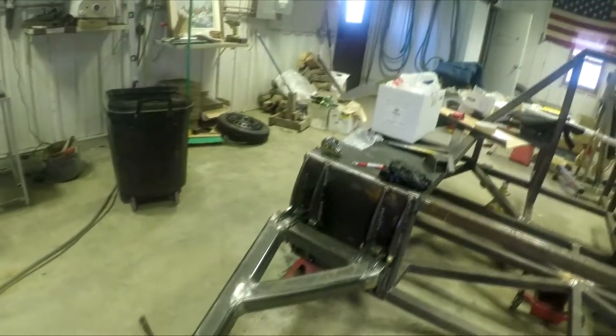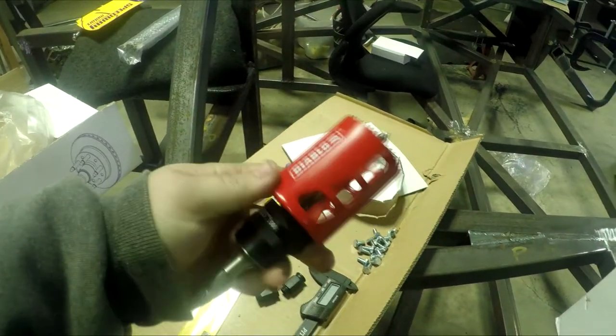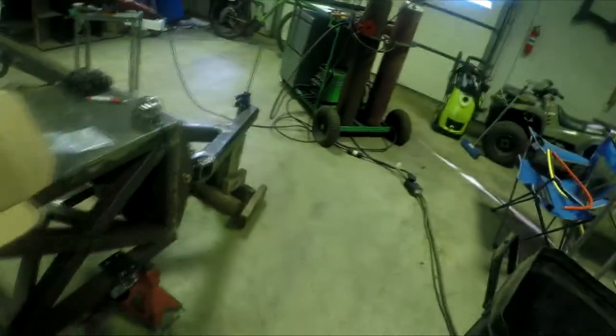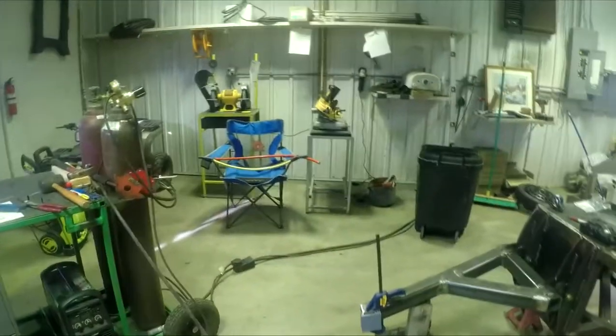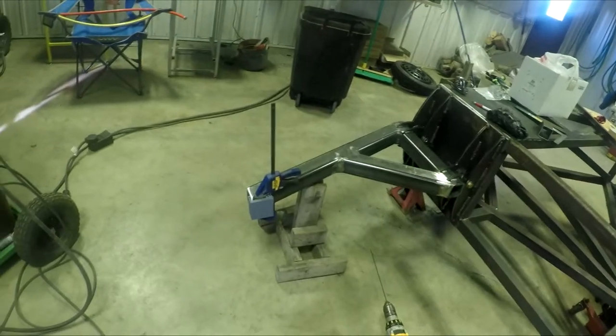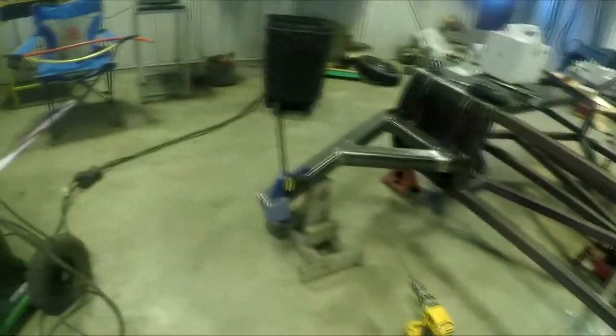And then we'll bump up to maybe go through with one other size. And then we got the hole saw here. 2-inch hole saw, Diablo. Cost me a lot of money, so hopefully it works really well. I'll just have to take my time and use the electric corded drill so that I'm not going through batteries constantly. And probably I'll use some WD-40 as some cutting oil, especially in the 3D printed part. That way I don't melt it and I can hurry up and do both sides, and then I shouldn't need that anymore.